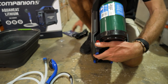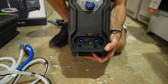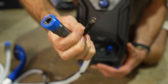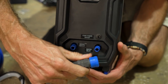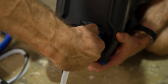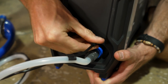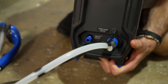The only attachments needed are the water inlet and outlet at the bottom. The inlet is the pump, which has a combination water hose and power cord because the pump needs power too. To connect it, pull the collar back, push it on as far as it will go, then push the collar down to lock it in place. Then plug it into the power outlet. Make sure the unit is off — the pump shouldn't run when it's not in the water.